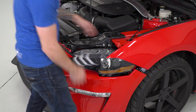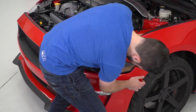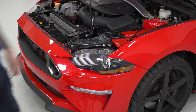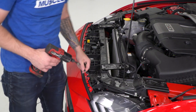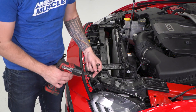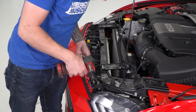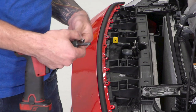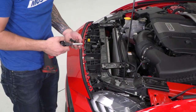Once the bumper support is in place above the radiator, go into the wheel well, make sure the lip is over the headlight, and snap it into place — do that on both sides. If you remember, we did a bunch of bolts up at the top going straight across the top line of the bumper. The ones on each corner were 5.5-millimeter bolt heads, so get the 5.5 socket on the impact gun for those first, then swap back to the 8-millimeter socket to finish the rest, then back to 5.5 for the other end. Don't over-tighten — just nice and snug.